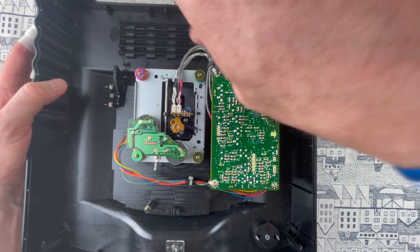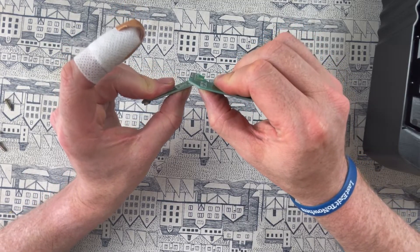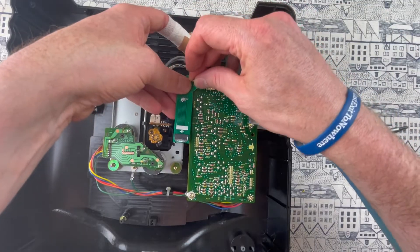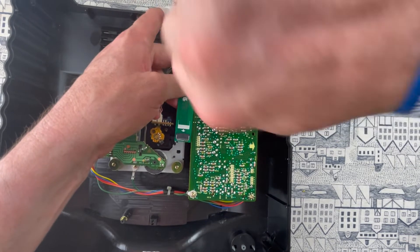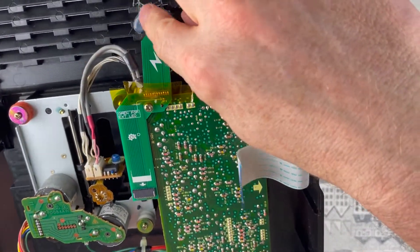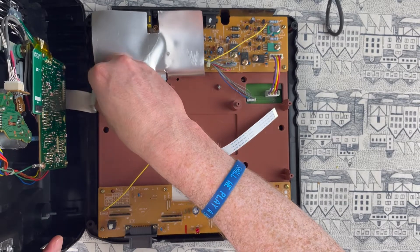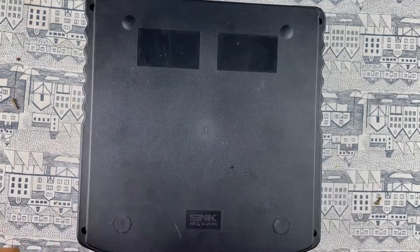The last part of the mod is to fit the SD card reader. Remove this screw, take the reader itself and bend the two parts — connected with pins in the middle — to about a 45-degree angle, then screw it back in between the screw and the drive board at the top, with the ribbon cable connector facing down. The SD card slot should poke through the vent hole, but it was a little wobbly so I fixed it into position with a glue gun and put some Kapton tape over the pins.